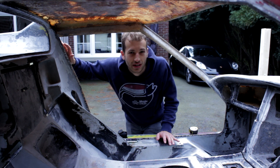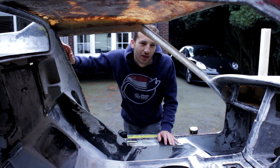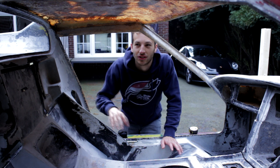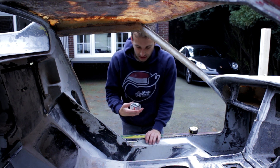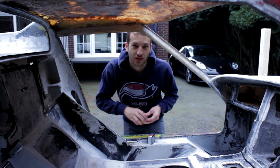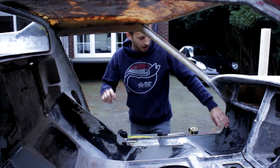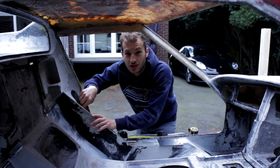The specs call for 38mm diameter tubing with a 2.6mm wall, CDS — seamless tubing with specific strength measurements. We're going to use FIA mounting plates. I used a lot of different tools to measure everything: an angle gauge, tape measure, and an angle finder. The chassis runs through here and we're going to have a sill bar essentially, which will go from the footwell all the way in the sill to the other side of the bulkhead.